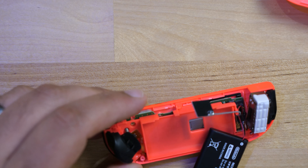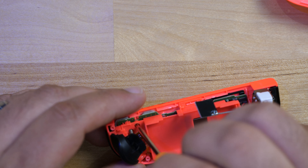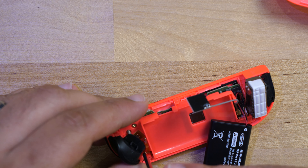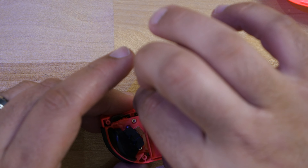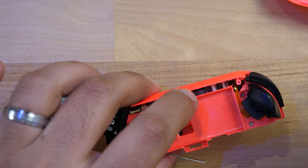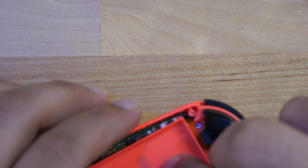Here's the centerpiece — there are no center screws like I expected, but there are two screws up top holding it down. Remove any screws you see and be very gentle. This is very small, very delicate stuff — if you're too aggressive with electronics, you're going to damage something. Once the screws are off, this should come off pretty easily, but watch out for one ribbon cable right here — I'll zoom in so you can see it.